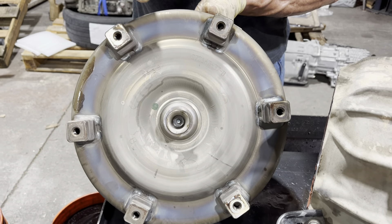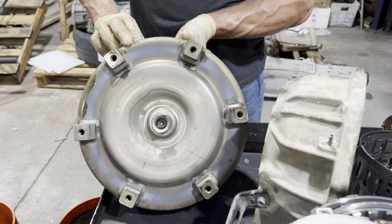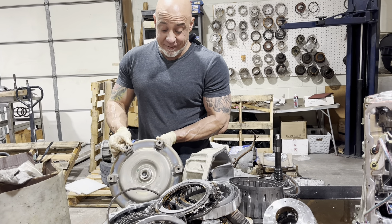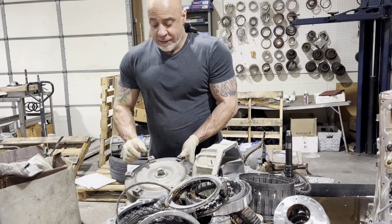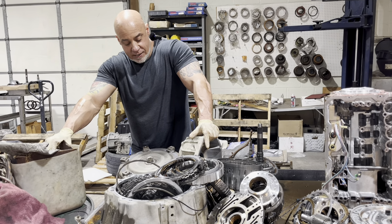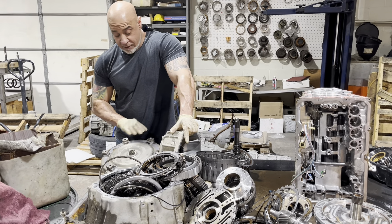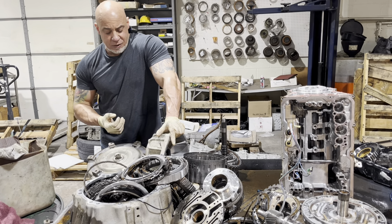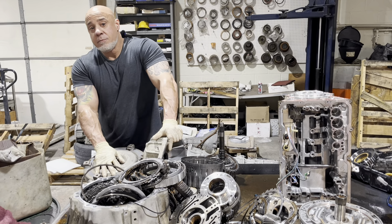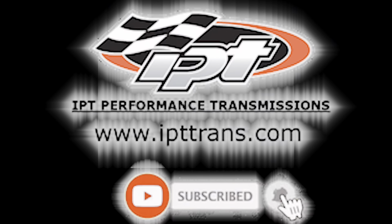Look at this torque converter - this is where your clutch rides against the crankshaft side of the torque converter, and this thing is absolutely blue because that torque converter clutch got so hot. If you were inside this bell housing while this was going on, this would probably be glowing red in there. I don't even want to rebuild this torque converter - there's no way everything in there is straight and not warped, so this has got to go. This is extraordinary - I've never seen a Tundra torque converter get blue like this. I've seen it in a bunch of Fords and a lot of diesel stuff, but never in one of these. So this has had a hard life for sure. That's about all I've got for now, and hopefully we'll have some subsequent videos coming up for this transmission. Please like, share, subscribe, and hit the notification bell.